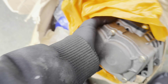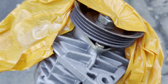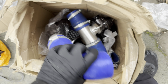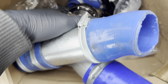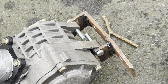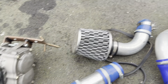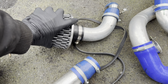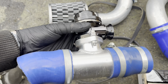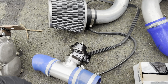Upon closer inspection we can see that we do have an AMR500 supercharger with a serpentine pulley on it, a serpentine belt, and some pipes and there should be a bracket to mount said supercharger. There is the bracket to mount the supercharger, already attached to the supercharger. So what have we got? We've got this to go on the intake to the supercharger, this to come out of the supercharger, this to perfectly regulate the boost absolutely perfectly, and then some pipes just to connect it up and a belt to make it work.